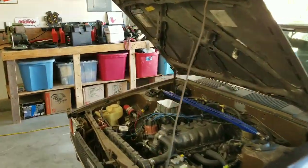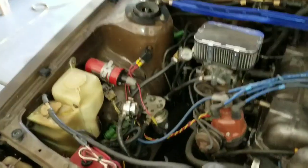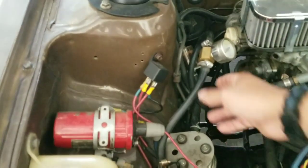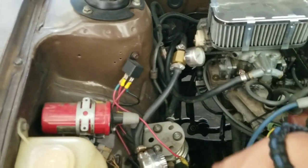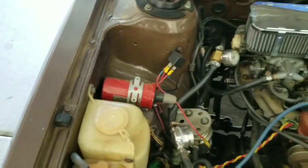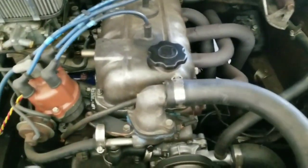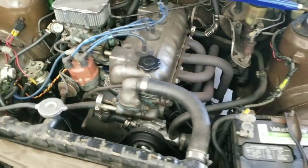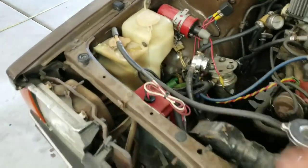So here's the car, you guys hear it? Sounds pretty fast. Some of the things that I want to do: this fuel hose is already cracking here. The filter is dirty and it's going to stay, but I would like to replace all the fuel hose. The relay for the fuel pump, I would like to tighten up those wires and cover this up. I want to be checking the timing as well, while I'm checking the air and fuel mixture with a wide band portable gauge that I have. I want to clean this area out right here a little bit more.